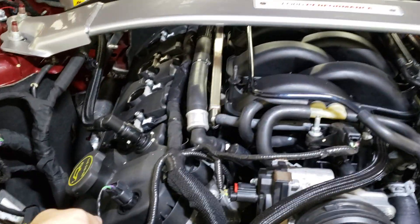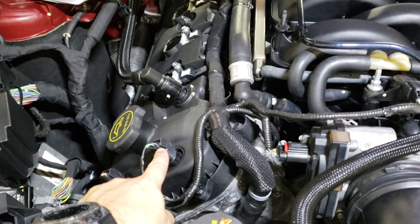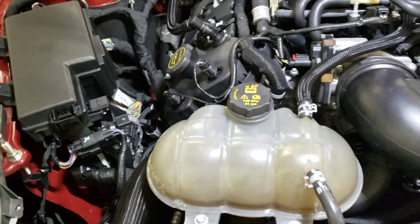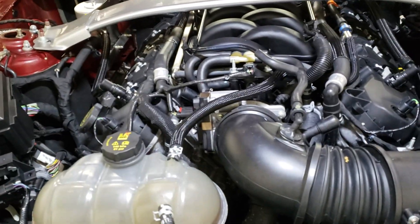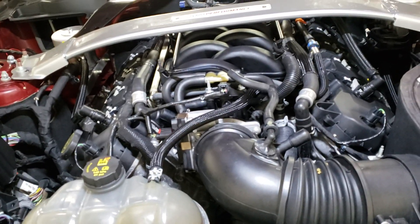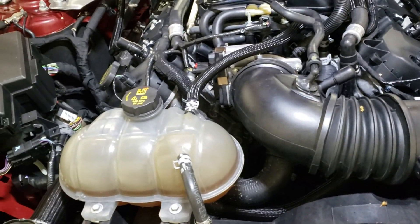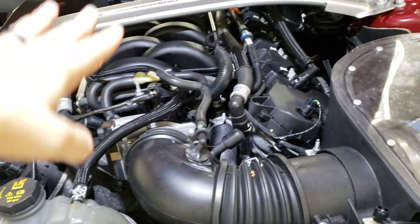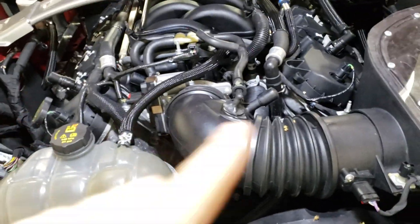The good news — I'll put a link in the description — is that you can buy this plug on its own. Fair warning: it's stupidly expensive at around $40, but you can buy just the plug (part WPT-1506). You could also try to repin it yourself. My recommendation is to just buy the plug and replace it if your engine harness is otherwise good. If you've had problems with your harness in the past — people have pulled wires or plugs by the wires — I recommend replacing the full engine harness. It's quite a bit of work but doable with the engine in the car if you remove the strut tower brace and intake manifold, and it's about $200.